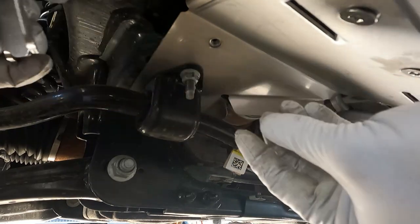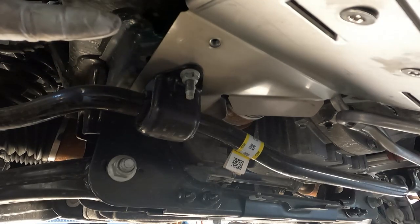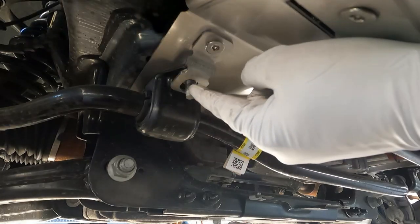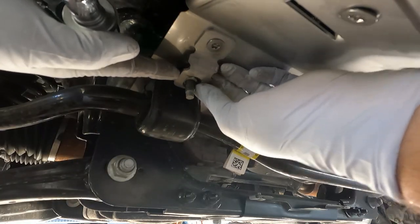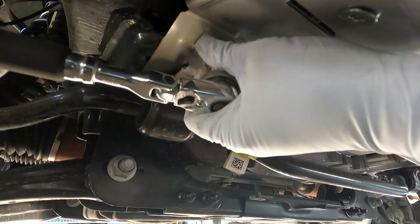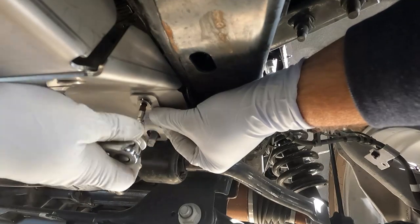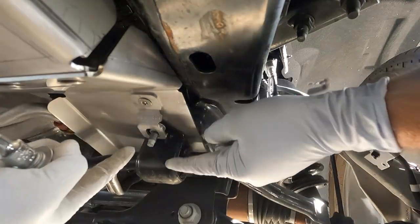The last step is to install the nut covers. That prevents somebody from being able to use a 15-millimeter socket to take this off, drop down the sway bar, and try to bend this down or get to the catalytic converters. Just position it over the stud and get the little M8 security bolt started. When you tighten this, you don't want it touching the stud — just get it snug and center it so it's not touching anything on either side. Give it a little bump with the ratchet to make sure it's still centered. This little thumb spinner comes in handy for this.